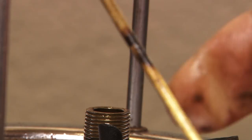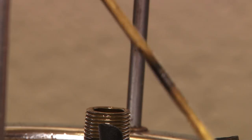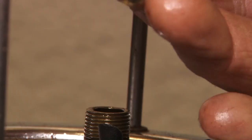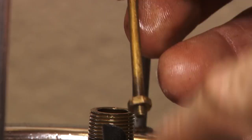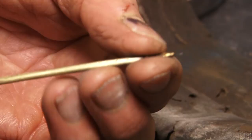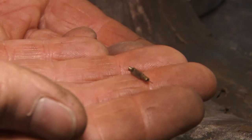Let's get that brass needle out — it's only done down here at the base, pretty well finger tight. There we go. You can see the carbon coming off on my finger. The whole rod comes out like that, and you can see there's the needle. I've got a bit of a buildup of carbon here and also carbon deposits there. You can buy these rods as replacements. You want that fuel to go out there nice and smooth, so I'm going to get some fine emery paper and just rub this down both here and here to help that fuel flow through.